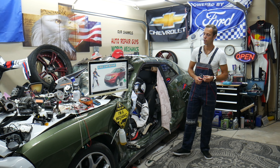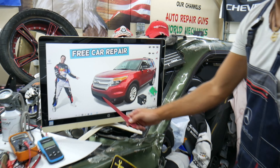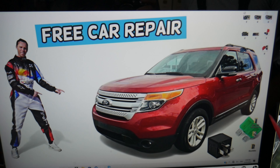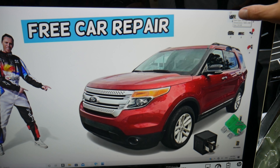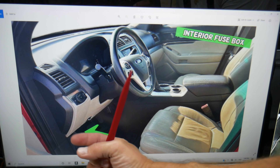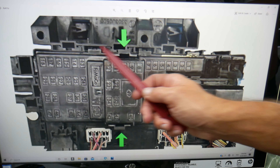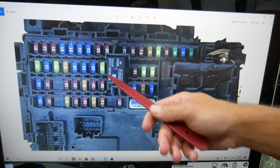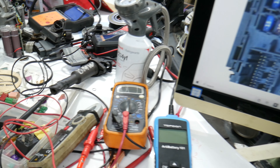So the HUD display — also known as heads-up display — fuses and relays: here's where you can expect to find them. We'll demonstrate on this Ford Explorer. Open the driver door, then on the driver's side come to the footwell compartment and look behind the parking brake panel, up in the dash on the very left side. There is a fuse box there. Press the two tabs together, pull that black cover out, and you will find the main interior fuse box with a layout like this one here.